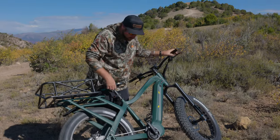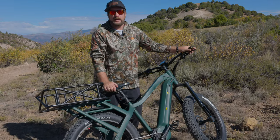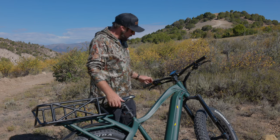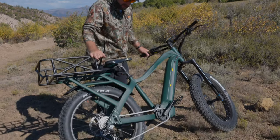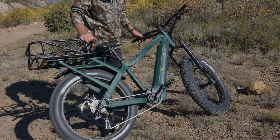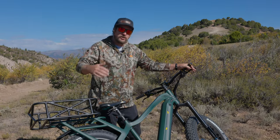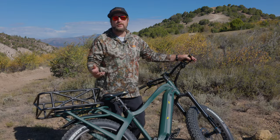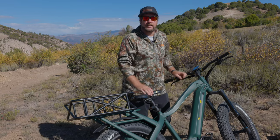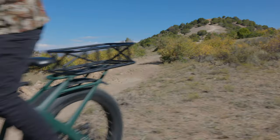We're now in gear number four. I'm going to go up one more gear so that I'm starting in gear number three. Now we're going to power the bike back on — it comes back up into power level one. I like to double check by leaning the bike back up again, just pushing the throttle a little bit and making sure that the gear shift has been completed. It's always important to make sure that the system is rotating without resistance when you're making a gear shift. So now that we're into the proper gear, we can go ahead and climb up this hill.